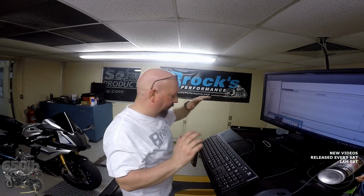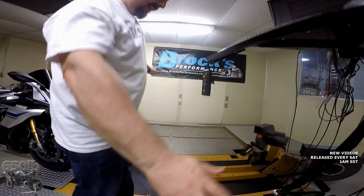And one of the things I like, so everybody knows, we stripped our dyno down to nothing. No wires, no stack. The only thing that stayed was the drum and the brake. We switched over to the new WinPep 8 software, and we no longer have the STD scale. We no longer have basically any of the readings that we used to have. So our 260 to 270 package is now running around in the 230 horsepower range. That's in line with all the rest of some of the other tuners.